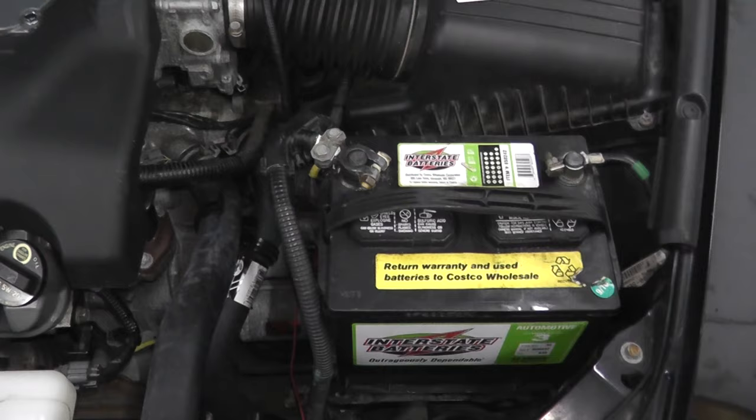But let's say you do all this and the starter is fine — you have no issues with the starter. What else can we check? Well, there's also a starter relay that we can test. Quick recap: we know that the battery terminals are good, we know that the battery is good, and the starter is good. Chances are, if you have this trouble, it's typically either the battery or the starter. But if you still have trouble, the next step is checking something called the starter relay. There's a relay for the starting system — if the relay goes, the starter won't crank. It's easy to test; the hardest part is finding the relay. Just do a web search — a lot of times you can pick up images showing where the relay lives for your specific vehicle.